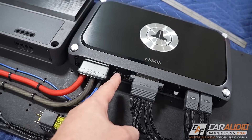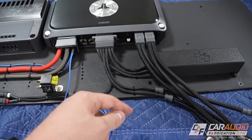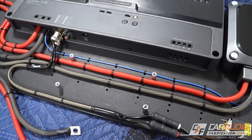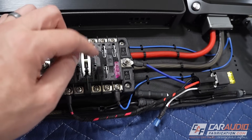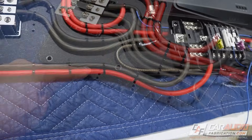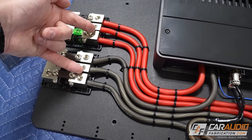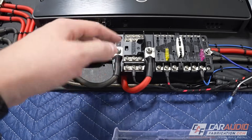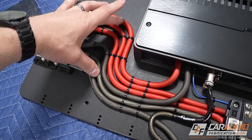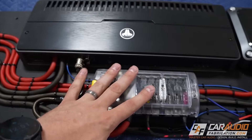Back to our amplifier rack — there are really only two other connections I need to make. One is for the controller I mentioned earlier — again it's a quick-disconnect plug, so I'll leave that loose to be easily connected in the vehicle. I do still need to connect the turn-on circuit and get my smaller fuse block reinstalled. I now have the remote turn-on lead connected to the small fuse block, and I made a change for the power and ground feeding the fuse block — they used to be wired on the other side, but since I got rid of those extra power wire connections for the additional amplifier, I rerouted them to make things cleaner. I've installed a new 30-amp fuse for that connection.